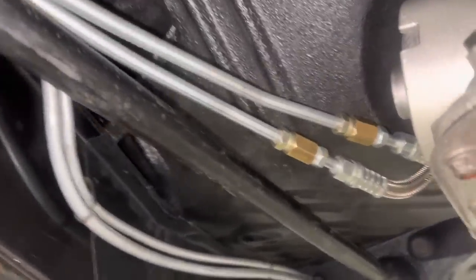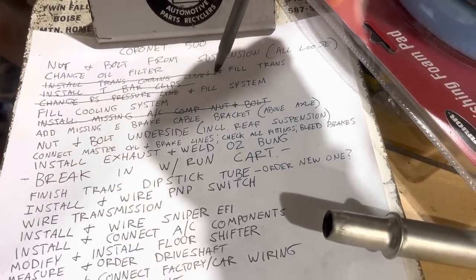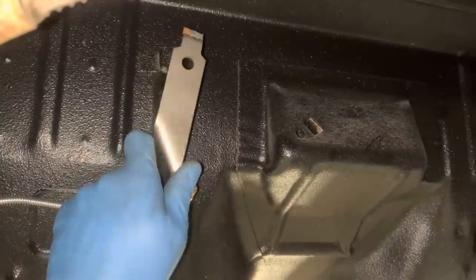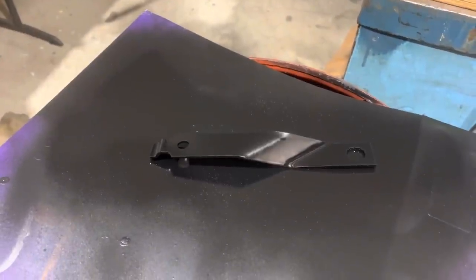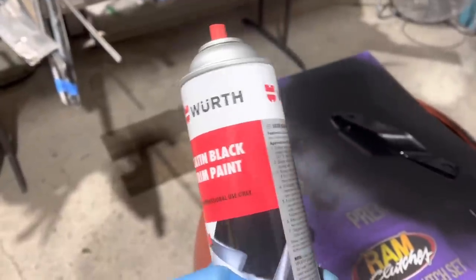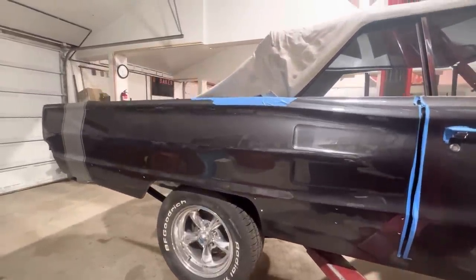Trying to think of everything here. It's a tight fit for these components and the last thing I want to do is create something that's going to make annoying noises, so you need to watch out for that sort of thing. I thought the bracket that held the brake line came from here — nope, it goes from here. Which means there's also a speedo nut missing. Paint it black and do something else. This Werth satin black trim paint gets a serious workout in this shop — it's basically the slightly nicer, more professional version of the semi-flat black I always use.